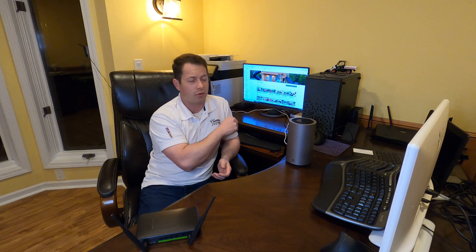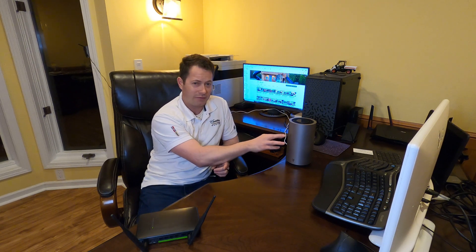You don't have to have port forwarding set up to use those cloud-based cameras. My other cameras are FOSCAMs, and they do need port forwarding — in order for me to view those from outside my house, I have to have port forwarding set up on my router. With this gateway, since it doesn't have the pass-through, that no longer works.